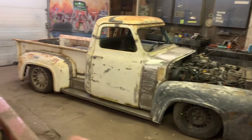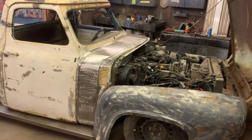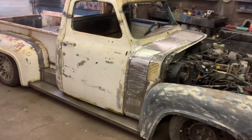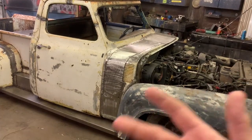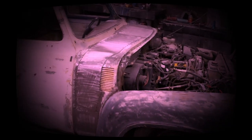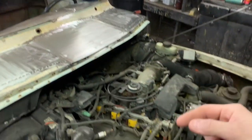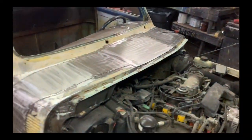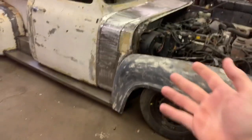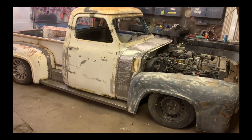So let's start here — why won't it run? The whole reason I haven't taken it for its first drive is because it occasionally doesn't want to start anymore. Maybe one out of every ten it'll fire up, run for like five seconds, then turn itself off. I had no idea why. I assumed maybe I had a bad ground somewhere, regrounded everything, still doing it. Now it won't even turn on sometimes, just turns over. Went through all the relays, all the fuses — everything is okay. I can actually hotwire my fuel pump and it still doesn't want to run.